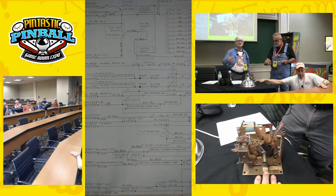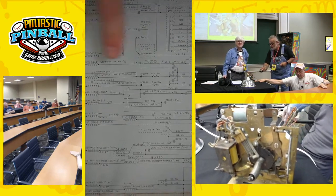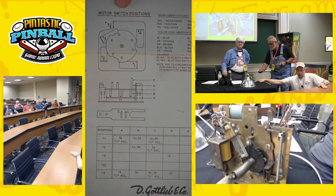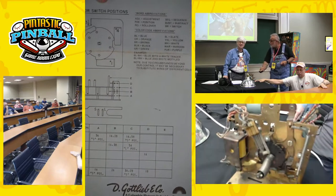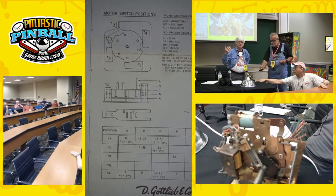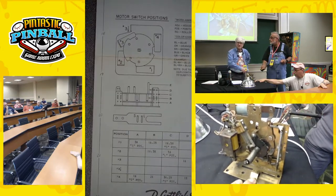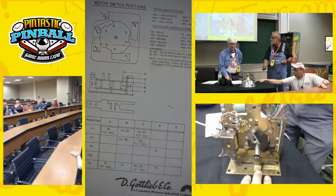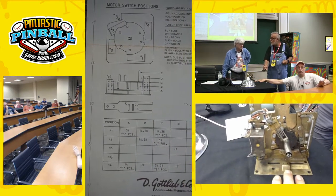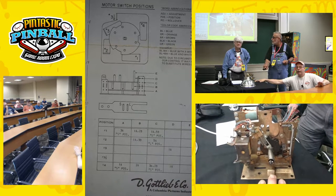The other one — the 100Ks — you're going to be getting enough pulses from the reset circuitry that if it is single-step down, that's fine, because in novelty mode the reset single-steps it down. So you don't have to find a flyback even if you do the 100Ks on your new stepper unit. Your new stepper unit you probably want to have more than five steps — go past 500,000. A bonus unit that goes up to 15, like end-of-ball bonus from Fast Draw, Lawman, or Sheriff, could be used to count your 100,000s.